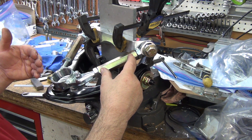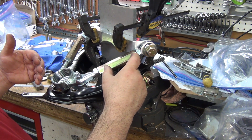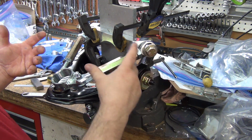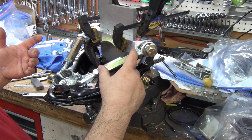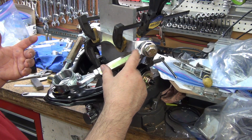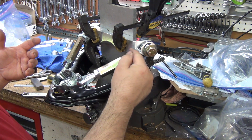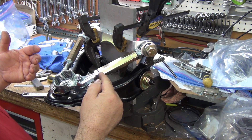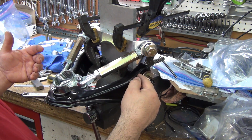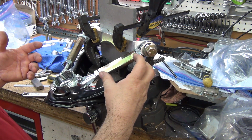If it needs to be pulled back and maintained at the same seven and a half inches, these will probably have to be shortened up a bit. I'm going to let at least the first few go out to get mounted up — I want to find out exactly where guys are setting them. They can grind an eighth or quarter inch off to shorten these up; they can take a cutoff wheel and lop off a quarter inch off each side without any problem.